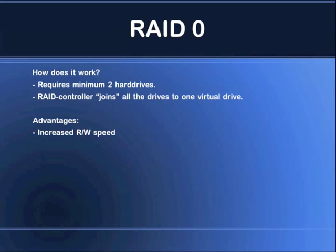If you have two 500GB drives on two separate disk controllers, each hard drive is capable of reading and writing 100MB per second. And when the RAID controller gets the data from the operating system and wants to write it to the drives, it writes to both at the same time. And thus you get the combined speed of each drive — up to 200MB per second instead of 100MB.